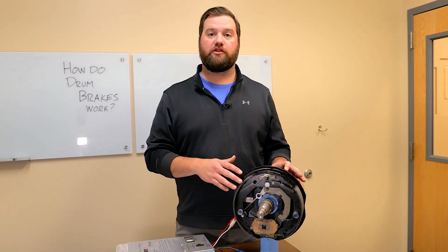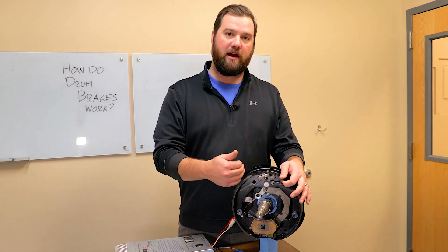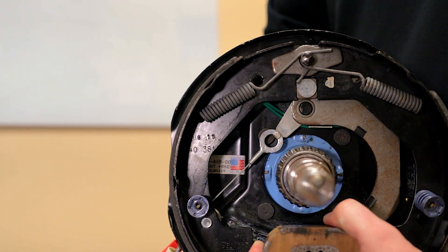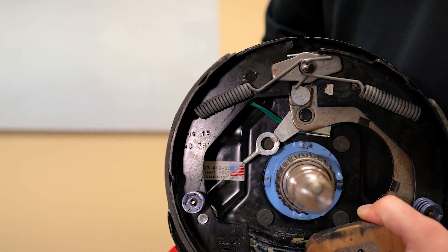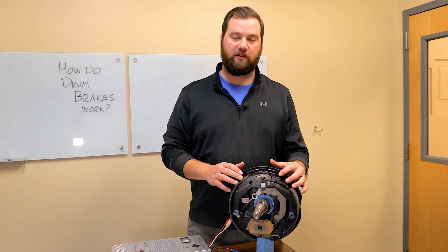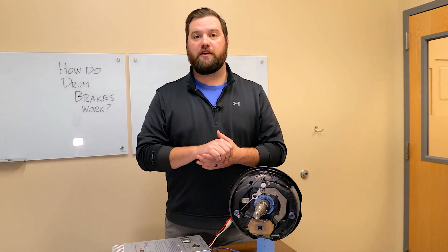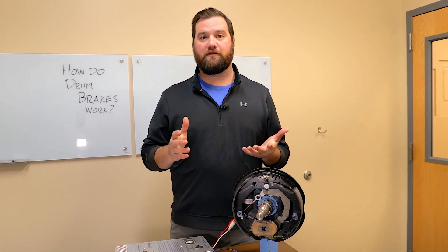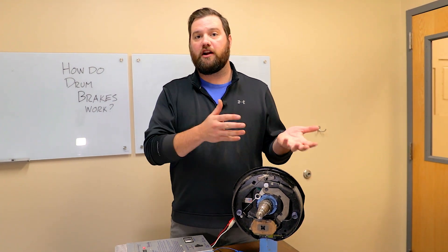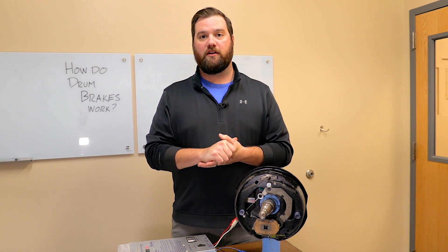In order to ensure smooth braking, after the first brake pad is applied, the harder you push the brake the more this pad is going to push against the inside of the brake drum, which will then activate the other pad. So it's going to start in different stages so that you don't have all of the application at one time. Hopefully this explanation was easy enough for you to understand how brake drums work. If you have any questions or comments, or another question you'd like answered, please leave it in the comments below and we'll see you next time.